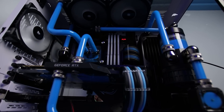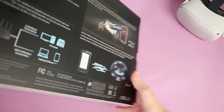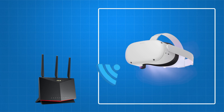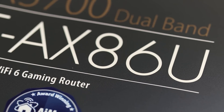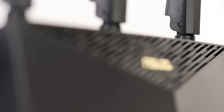These are the same system requirements as if you were using a cabled connection for Oculus Link, and I've added my own system specs in the description below if you're interested. The key difference with Air Link is that you'll need a good quality 5GHz Wi-Fi connection from your headset to your router for the best possible performance. The location of your router needs to be as close to your VR play space as possible and connected to your gaming PC using an Ethernet cable. This doesn't have to be the main router in your household and can be a secondary router just for this setup. I've added some links to some routers in the description depending on your budget.